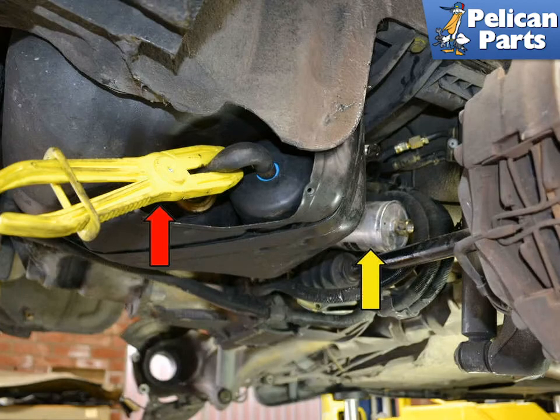The upper bolt on the right side can be difficult to access if you have an external oil cooler. I like to remove the fuel filter to give me more room to work. You will need to remove the access panel on the fuel pump and pinch off the line, then you can remove the filter. Even with the line pinched off, fuel will escape from the fuel filter and line, so be prepared. Please follow the link provided at the end of this video for all safety precautions and steps needed to do this procedure.